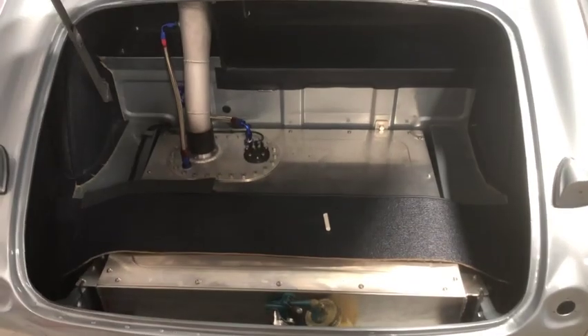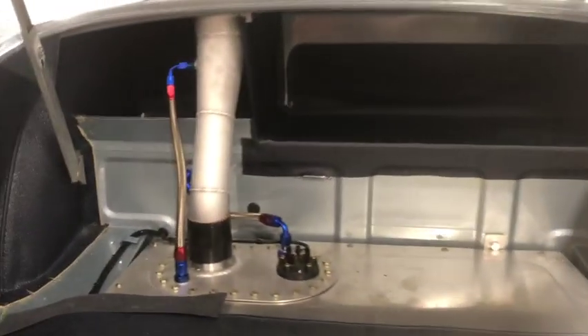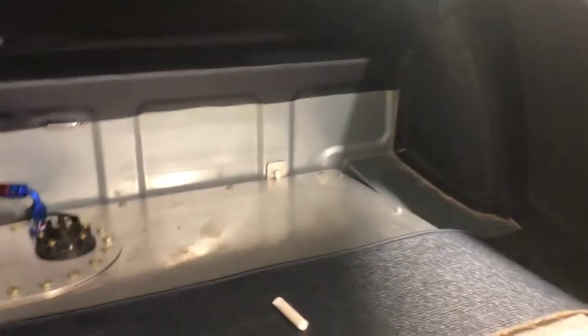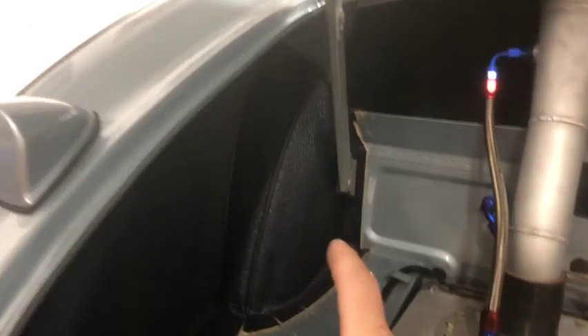Trimming the boot — sorry, I got a little ahead of myself and got started, but I'll show you the order of operation. The boot is all trimmed in Armchord pieces and it's all just glued to the bare steel, so pretty simple. But there is an order these things have to go in. The first pieces I always start with are the two side wheel arches — it's a sewn assembly, so it's all of this going up there. Put those in first, both left and right.